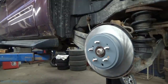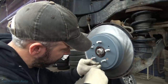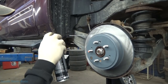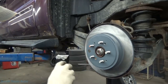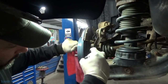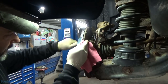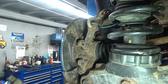We'll find our little rubber plug there — do this before you put the caliper on, because if you get all crazy and end up pushing this rubber all the way through, you don't want to have to pull the caliper and all that stuff back off. Learn from my mistakes folks. Then we'll get our little napkin here — lots of brake clean in this video, gonna be lots of happy viewers — wipe off the packing oils inside and out. You can also just clean these off in the sink with soapy water — that works just as well, just move the dirty dishes before you do it or your wife will get mad.